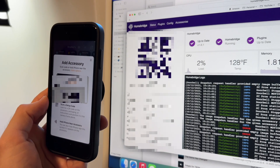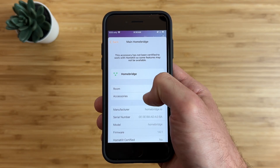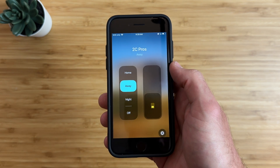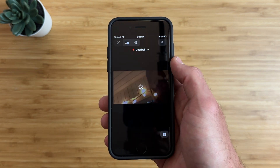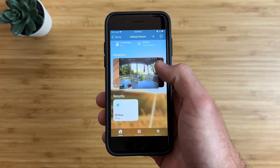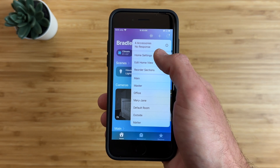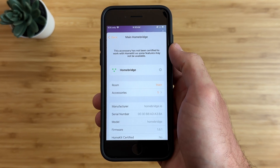The first way is bridging a device to HomeBridge. When you add the HomeBridge to the Home app by scanning the QR code, all the plugins and devices connected to HomeBridge will automatically appear in the Home app. Once the Eufy plugin is installed and configured, you should see the Eufy base, the doorbell, and any other accessories. The base is exposed as a security system and you can switch modes configured to match the Eufy app modes. The doorbell loads up really fast, and you'll also see switches for toggling motion and power.